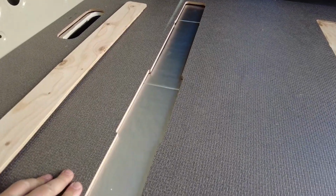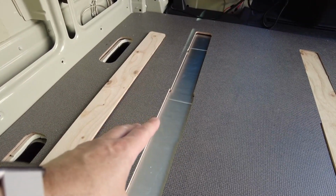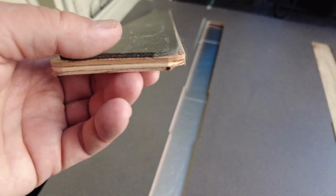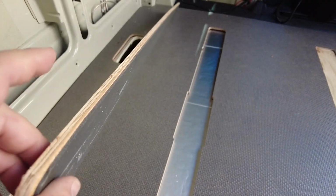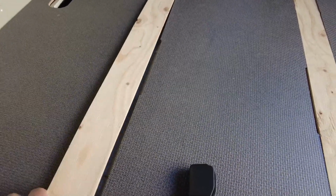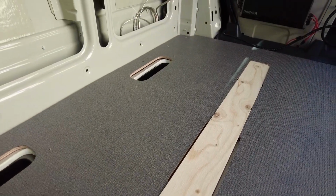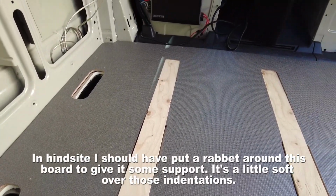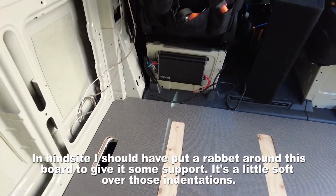So when I pulled this floor up, there's a bunch of foam on the bottom of this floor and staples, and so I pulled all that out. Actually, it's just a real thin piece of foam, and so what I did is I cut a piece of scrap plywood that's about a 5/16 inch thick, and I glued that foam back on this plywood just because those two things are about the right height here to where when I put the floating floor over this, that it should support it. So just, you know, it's nice to reuse materials. So I was careful when I stripped up this floor to peel that foam off it and use it carefully.